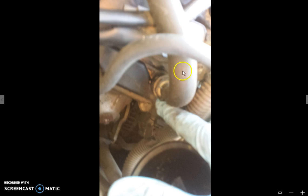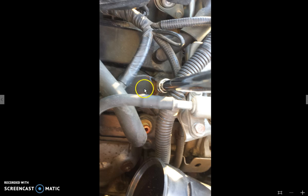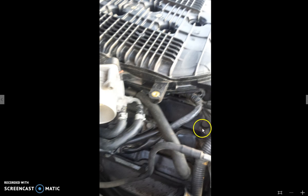So here we are. Here is the tube that we're going to take apart. We just need to unclamp it to get that one thing out of our way. This is the only tube that we'll take apart or take out on this side. And so there is our first spark plug coil again. There's its bolt, a little 10mm bolt, and there it is. So this moves one of the things out of our way, and now I can kind of get to it. But there's all these wires here. Let's take apart the entire car and show off. No. How about we just take that off and then just give it a little wiggle, and then just pull it out anyway. So that's all I needed to do there.